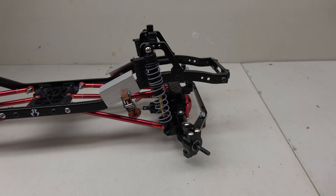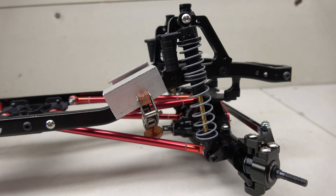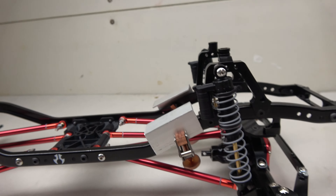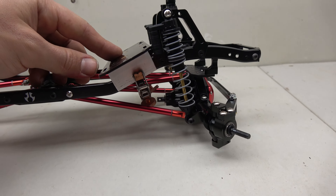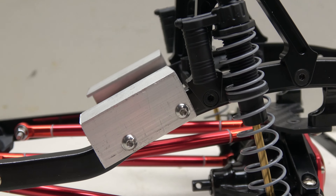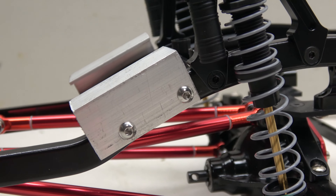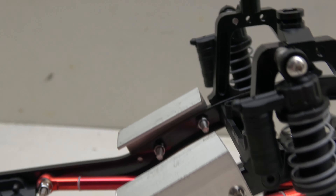The first step is to mount your aluminum angle to the chassis like so. The key is to have them as low and as far forward as possible without interfering with your shocks, your suspension links, or your motor. Do a quick mock-up with your battery plate to make sure nothing interferes. Then drill the holes and install your screws to fasten these plates to the chassis rails. Make sure your holes are nice and centered on the chassis rail and install three-millimeter lock nuts from the back.